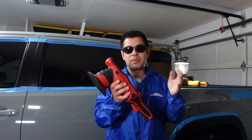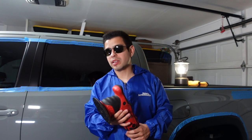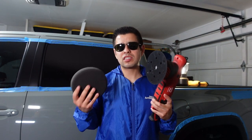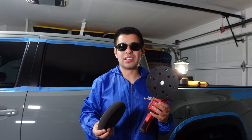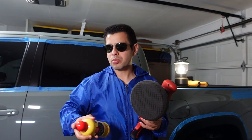This thing is going to see dirt and trails, so it should have as strong a coating as possible. I'm going to do a light polish using my Griots polisher — I've used this on my Camaro, my Mustang, and a few other cars. I'll just be using a lighter finishing pad. These dual action orbitals are really easy to use — I used to be worried about burning paint, but they're not going to burn anything. It's really equivalent to rubbing really fast by hand and you don't have the power to burn through clear coat. I got the pad on there and I'll be using Griots polish I want to use up.